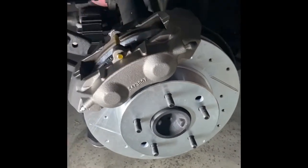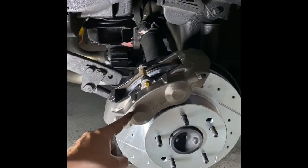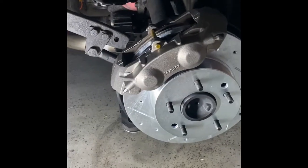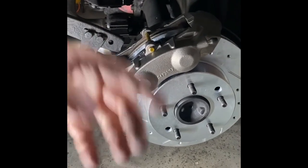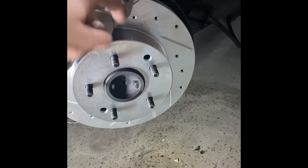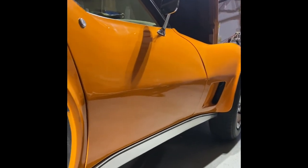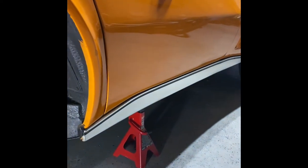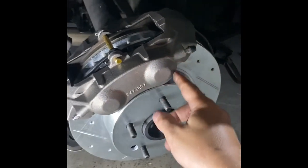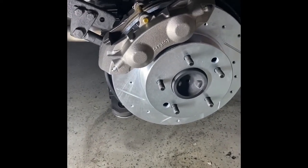It was easy to compress the pistons because there's no pressure due to the brand new calipers. I made a great video on gravity bleeding of calipers — go ahead and subscribe and look for that video: C3 Corvette Gravity Bleed Made Easy. You basically open up the highest point, and as long as these calipers are lower than your front and rear bank in the master cylinder, they will start dripping and the air will purge out. Make sure you have some paper towels down to catch the fluid.